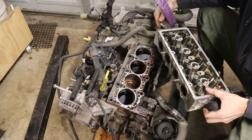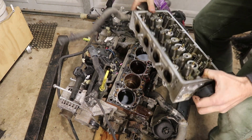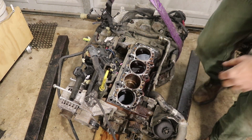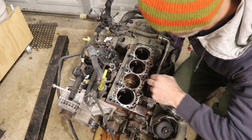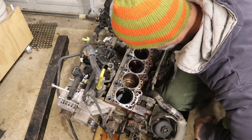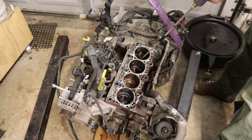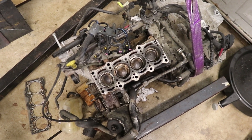There we go — look at those pistons! This is the mystery and the moment we've been waiting for. We can finally see these pistons and see what's going on. We've got some fluid sitting on these cylinders. This one cylinder has no fluid — and that piston looks messed up. Let me siphon the fluid off and we'll take a look.